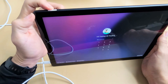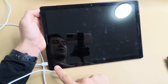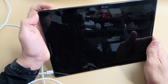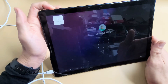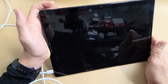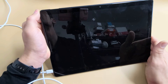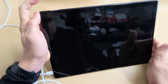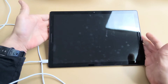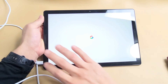After that, we're going to do the same thing with the power button. Let's pretend the screen here is totally black. While it is plugged in and charging, press and hold the power button for 10 seconds — 1, 2, 3, 4, 5, 6, 7, 8, 9, 10. It's totally off — let go. Now count 10 seconds again — 1, 2, 3, 4, 5, 6, 7, 8, 9, 10. Now just turn the tablet back on — just tap the power button and wait for it to boot back up. Hopefully you can see the screen.